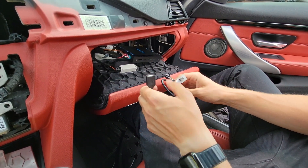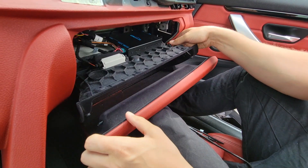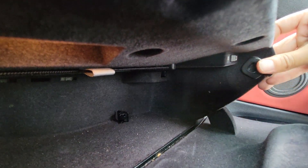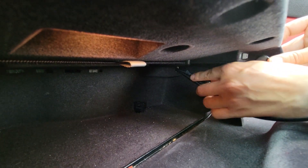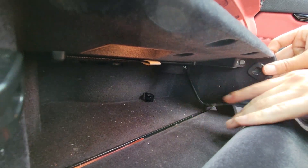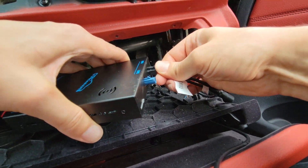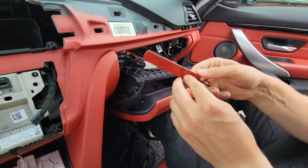The radio is in. As you can see now the LVDS in cable is long enough and we will plug it in here. When you're putting this back make sure not to jam this wire behind because sometimes you can jam it in and you're not going to be able to connect everything back. You should have two cables hanging out — so three total. Next is this USB connection which will go inside the glove box. We're going to open the glove box and as you can see there's this plug which you can just remove with your fingers — that way you don't have to drill any holes. If you don't have such a plug then you will have to drill a hole to feed the wire through, but most of these cars have it. Once you have it at the back of the glove box we will plug it into the USB marked connection. The last thing to connect to our module is the Wi-Fi antenna, which has double-sided tape on it.